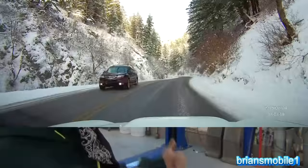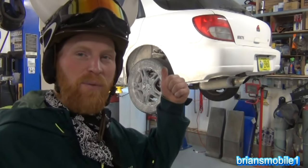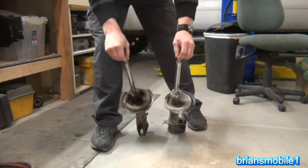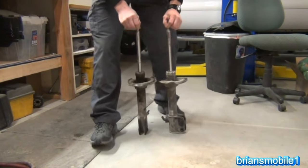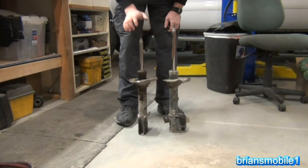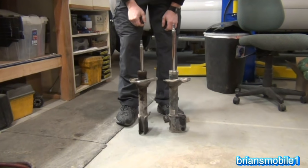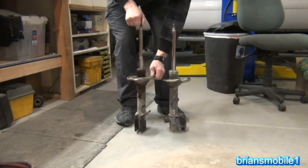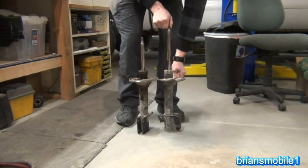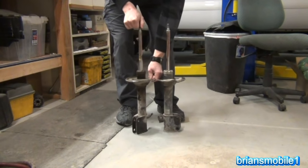The strut I'm going to talk to you about today is this one right here. I've got a couple of bad struts, and let me show you how I know. So here's the two struts — see if you can guess which one was leaking and which wasn't. I'm actually holding this one up; you touch it and it just starts to drop. There's just no gas charge left and there's free travel through this portion of it.